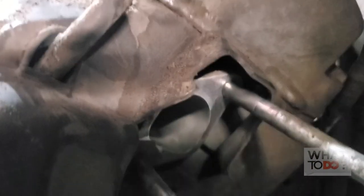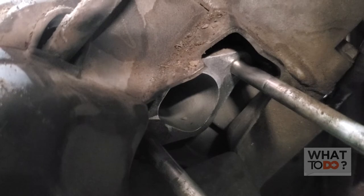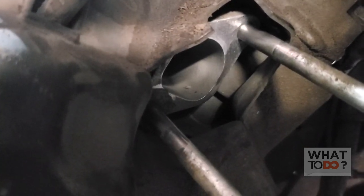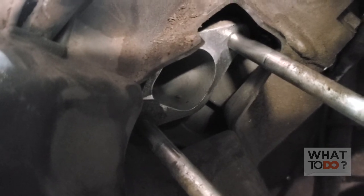That is the inside of the motor there. It's really difficult to see, but there's a lot of dirt and debris that had probably been taken in there. We're going to get an air line and try to blow some of that out as well. And that's it — right now we're going to go dip that carburetor into the parts washer, spray it down with some carb cleaner, and focus on getting that carburetor as clean as we can, then bolt it back up.